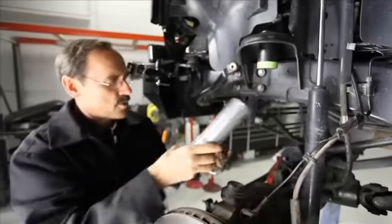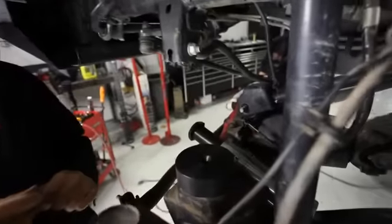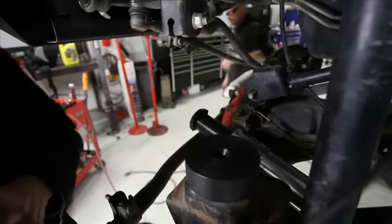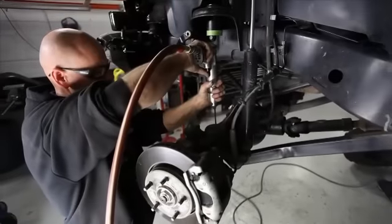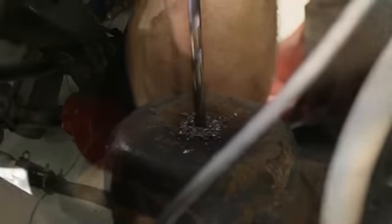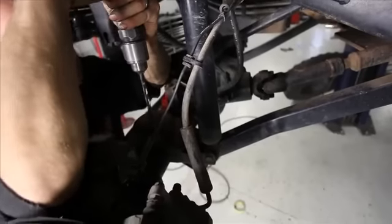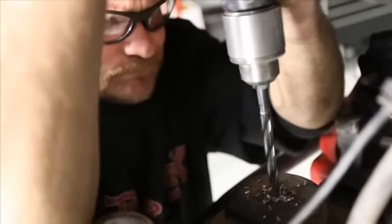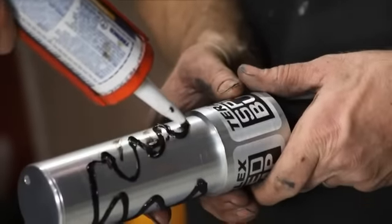Before we finish putting that speed bump into place, we need to install our bottom pad. It just goes right onto that spring bucket on the bottom — just center it up, get it squared up on there. Then we're going to take a center punch, give it a tap, and we're ready to drill. Drilling a pilot hole with a small bit will really speed up that drilling process. A little coat of silicone will stop any corrosion and electrolysis between the dissimilar metals, and it also works great as a noise dampener.